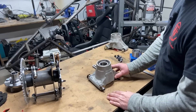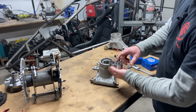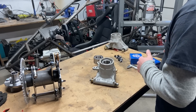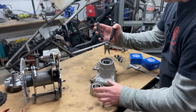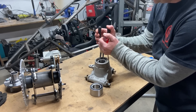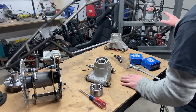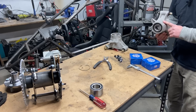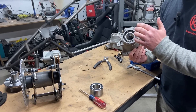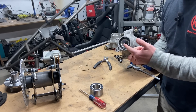First things first - these are used hubs. This bearing is the one prescribed by JD's Garage to press in to use Miata axles, so it's just safe to replace it. You'll need a special bearing press tool - I picked this up at NAPA on the cheap. The first time I went to change a bearing, you have the choice of buying a new hub for $100 or getting a $20 or $10 bearing and replacing it. It didn't take long to figure out I'd make my money back quickly by just buying a press.